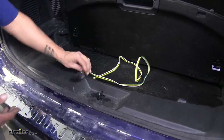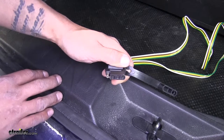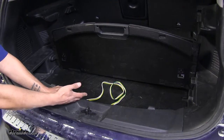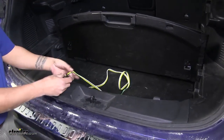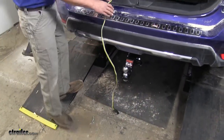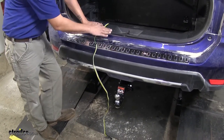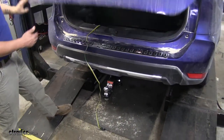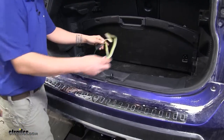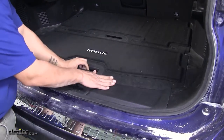Here's what our wiring is going to look like. It will provide us with a four-pole flat trailer connector and all required lights to get down the road safely, such as our taillights, brake lights, and turn signals. Our wiring is going to stay on the inside of the car until we're ready to use it, and when we do want to use it we can simply drop out the length of four-pole wire right by our hitch using the weather stripping. Then we just drop it out, close the hatch, and we have plenty of length of wire to hook up to our trailer. Whenever we're finished towing it'll conveniently stow underneath the compartment, nice and out of the way.